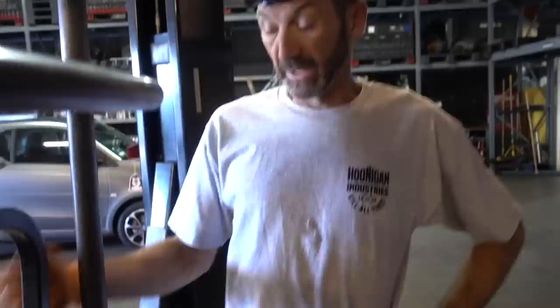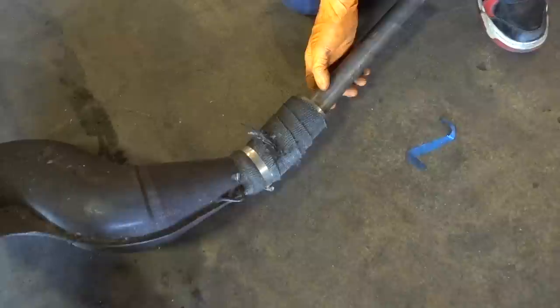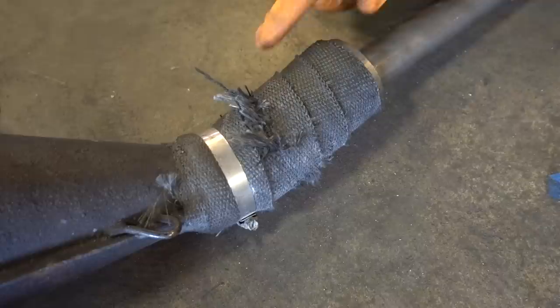So that's the extra water pump? Yeah, this is gonna be our new water pump that's gonna hopefully flow better. I'm placing it really close to the head, but we're gonna go right to the fan so that we're sharing the same leads as the fan, so that we know the fan's on, we know the water pump's on. That's cool. You're gonna shrink that down to that? I agree with everybody saying that we need to shrink this down, but I kinda wanna keep this fat, so I think I'm just gonna pie cut a bunch of these and then smack it down and then weld it into that.